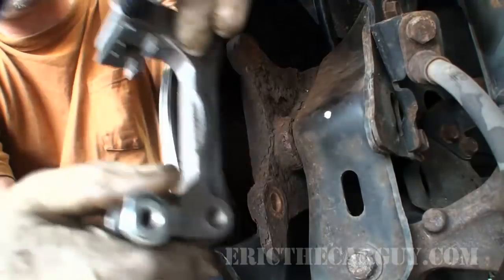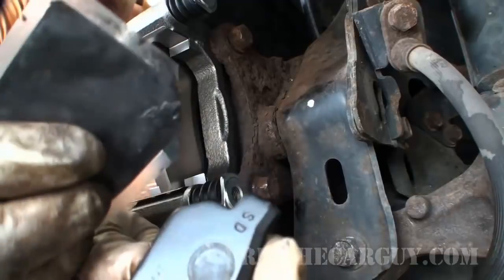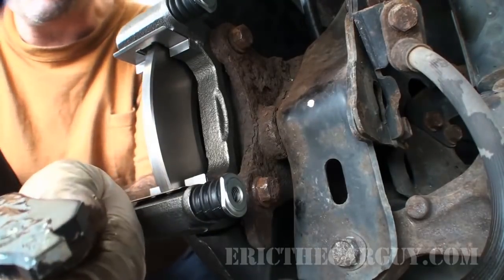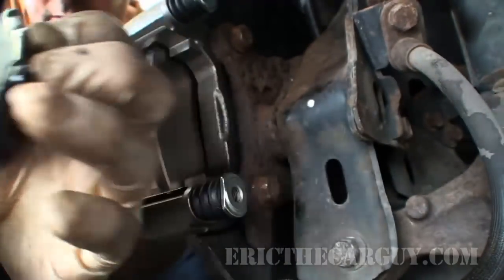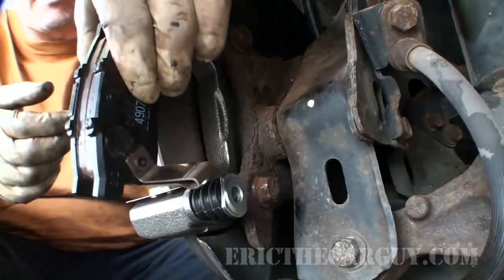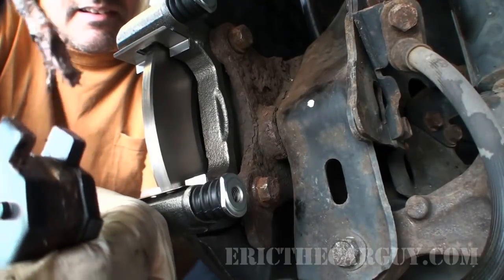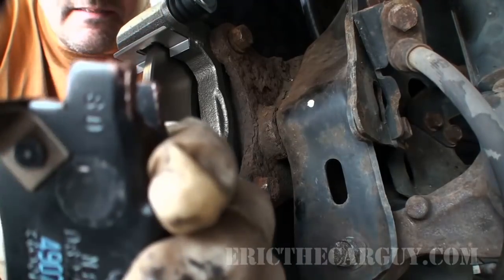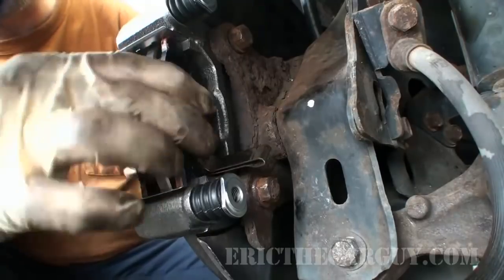Put your 14s with your washers. These are OE pads and they come with this little tube of moly grease — molybdenum. Just put a little bit on the outside of there, underneath the shim, then put the shim on over the top of that. On these, the wear indicator goes down — it's on the bottom. Take a little bit of anti-seize and put it on all the corners of the pads, same on the other side, just where stuff slides. Inner pad goes in, outer pad goes in.